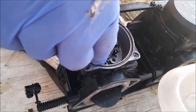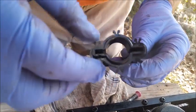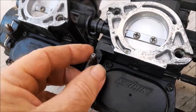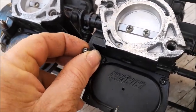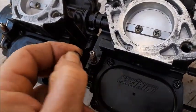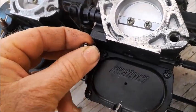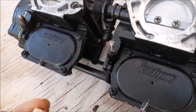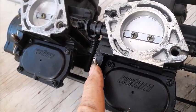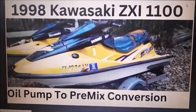This piece is not symmetrical so there's one way that it goes in — you can see how one side has a little bit higher arch than the other side. There are three hose tips that come out the back side of this — this is actually the oil injection. This unit is about 25 years old and you'll see how these oil lines have completely disintegrated. So if you haven't converted to pre-mix and you're getting anywhere close to this kind of age, you definitely need to do that. Before you can reinstall these carburetors, these have to be capped off. You'll need to get an oil pump pre-mix conversion kit that will give you the little plugs for these.